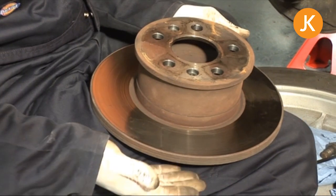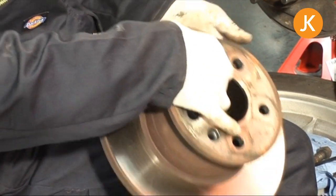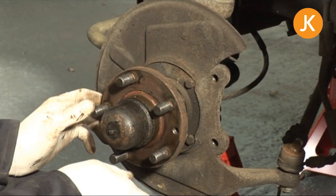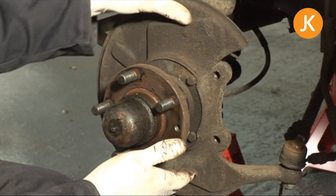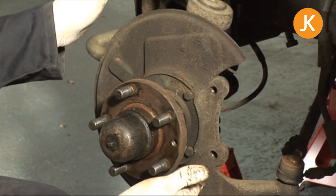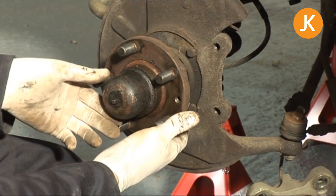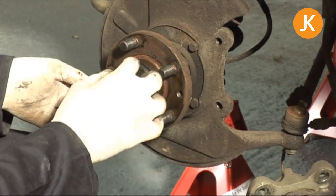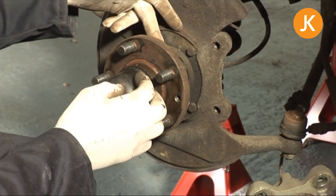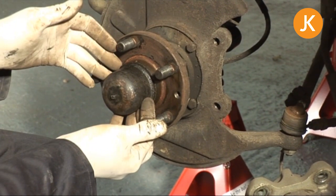You can give it a good inspection, or if you're just going to go straight ahead and replace the disc, get the new one ready. It's a good idea at this stage to give the backing plate a good cleaning down and a good inspection. If you need to, you can fit brand new ones from JustCampers. And of course your wheel bearings — the outers and the inners are just in here. It's a simple case of removing the speedo retaining clip and taking the dust cover off.